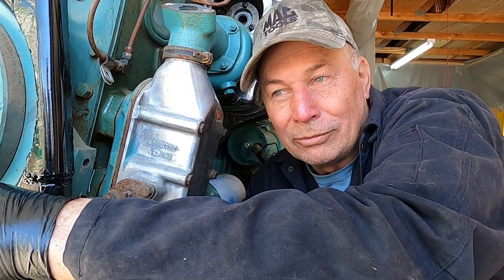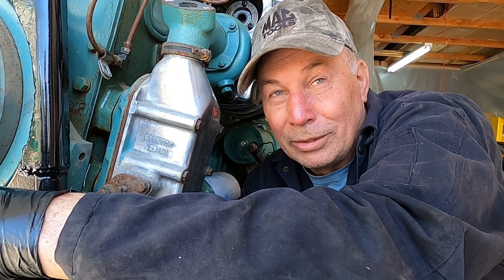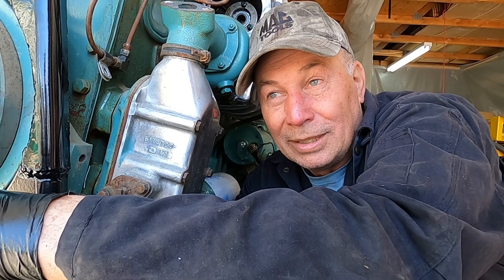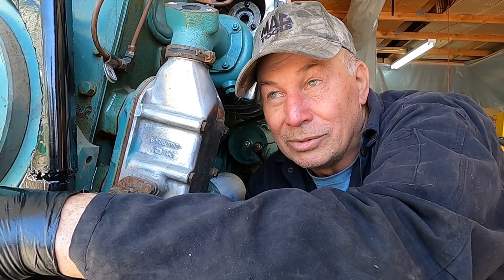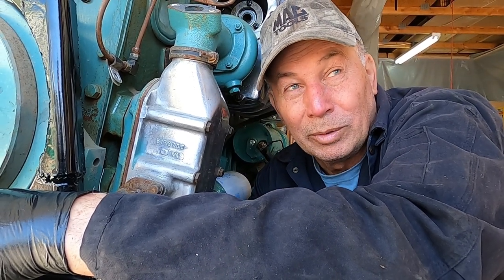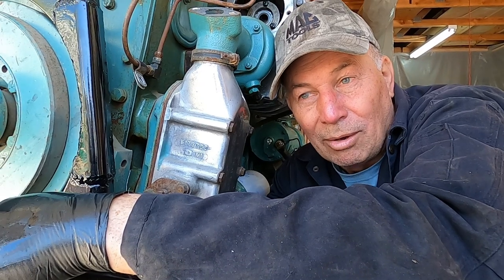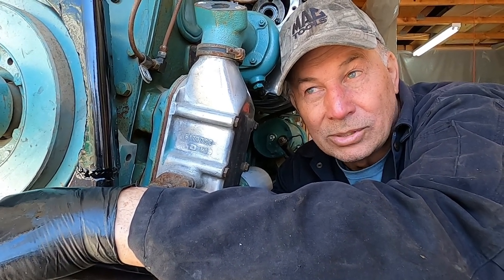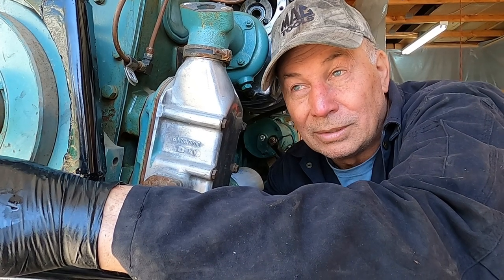When we got it done, it turned out there were a pair of sister engines in the boat — one on the right, one on the left. Now you've got one that's bored over and the other one's standard, and that makes them run weird. It ran weird to begin with, and the problem was that somebody didn't bother to check timing. One port engine was already advanced-timed and was about a half a tooth more than that.